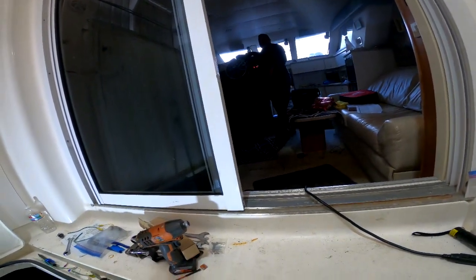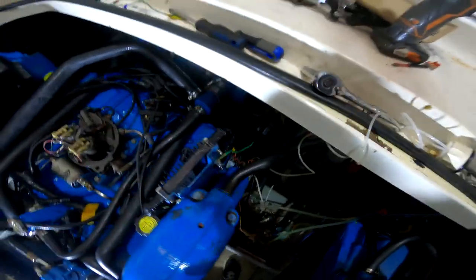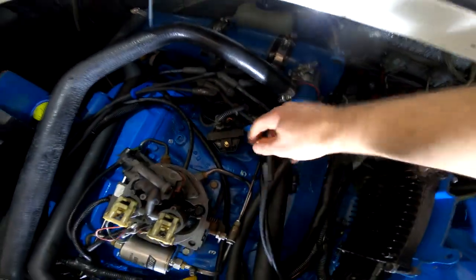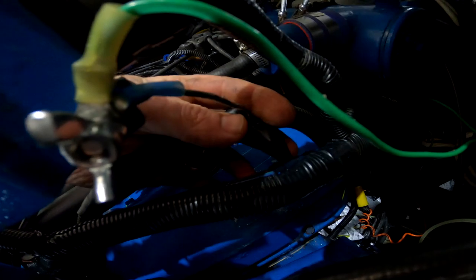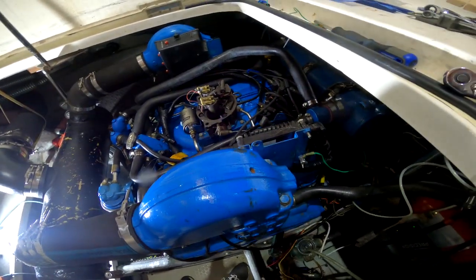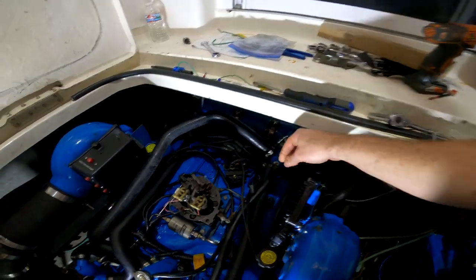It got up to 40. So it's actually working up there now - it's probably that wire. One thing I didn't show you guys: we did find a wire coming off of this harness down here that wasn't connected - that little short, stubby one right there on the harness. That's the one we think contributed to our issue. So this whole time it was already building oil pressure - we just didn't have all the wires connected. I'll shame myself for not labeling everything, I guess.